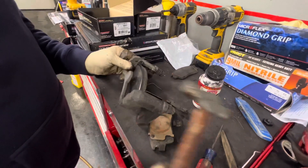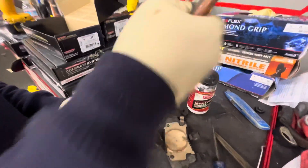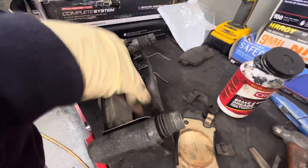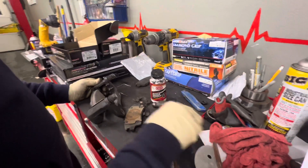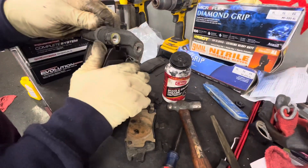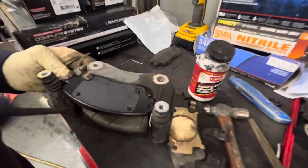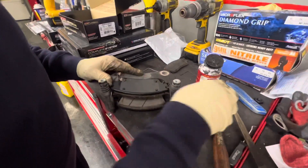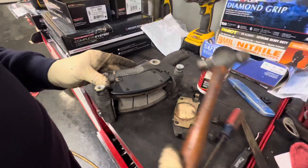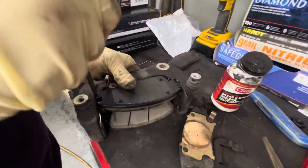Let that one down and keep it right at the very edge — we need the distance for the brake rotor to fit on. If there are any paw prints, use the sandpaper. The cleaned grooves from the file will make the brake pads go on easier. The outside pad goes on like that. Knock it down into place and make sure they're seated — if there's still a gap, you've got to push and wedge it down. Get a screwdriver in to wedge it down.